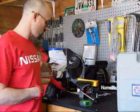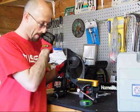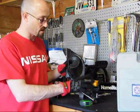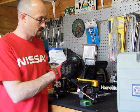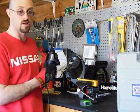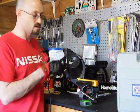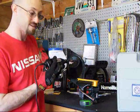I've moved inside into the garage, and next I'm going to take my finishers and cut out the center of them. You want to cut just to the inside of the bezel. I've put it in the vise with plastic clamps so it won't damage the finisher and I can see it clearly. Just remember, if you use a Dremel or anything similar, there will be flying particles — wear safety glasses or goggles. Once I get this done, I'll show you how it turns out.